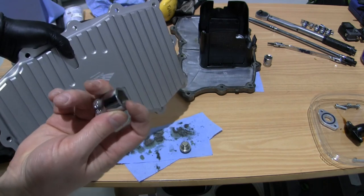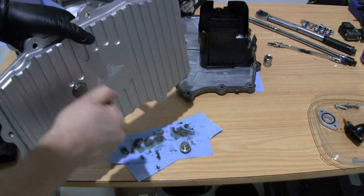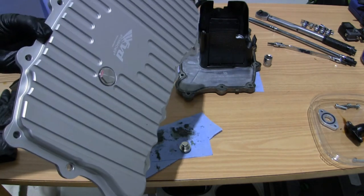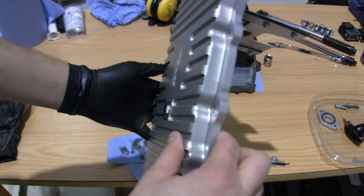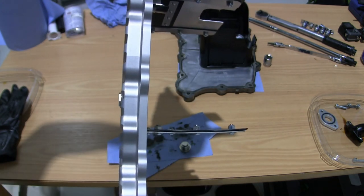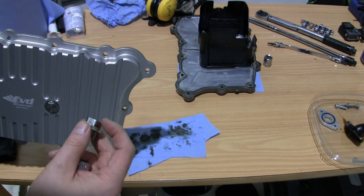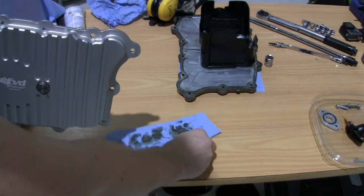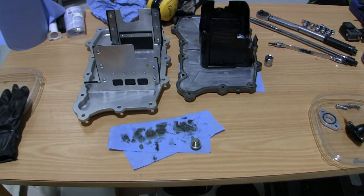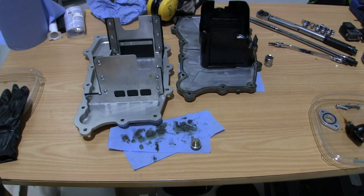As I said, I asked him to machine down the socket also, so I get a better grip. Okay, it sticks out a little bit, but I don't know if that's better to see from the light. You can see it protrudes a little bit from the oil pan, but it's minimal, at least compared to if I would have used this one. I think the original height is 7 mil, and now it's 2. So that should be fine. So just clean up the gasket seat on the engine, put sealant on here, and then mount it.